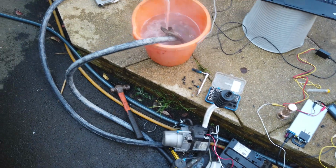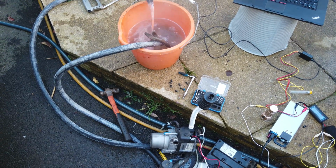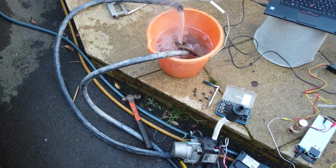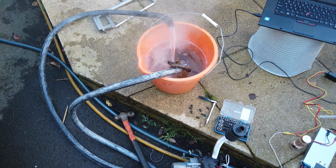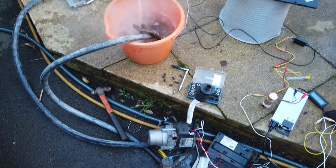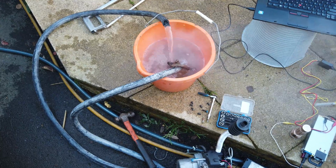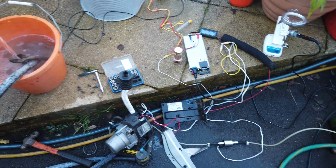One thing you definitely want to check out if you want to run one of these on, I don't know, your camper van or maybe your vehicle. If you search on eBay for a W bus adapter, I think it's called a W bus to analog adapter, I'll pop a link in the description. You just give it 12 volts and a switched live, so switch 12 volts, and run a cable to the heater, to the W bus line, and it will start the heater up as long as you're giving this little control board 12 volts. I think they're about £30. I'm going to be buying myself one now I know this works.